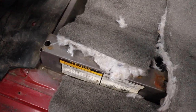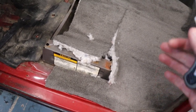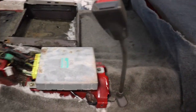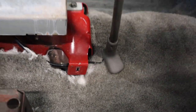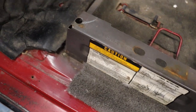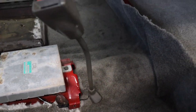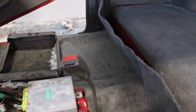This is some of the custom stuff you have to do. Get a nice razor blade cutting around the base of the seat. Leave a little extra material and work your way in — you can always cut more. You don't want to cut too much and be left with an open spot with no carpet coverage. As you're working through the middle portion, don't forget the holes for the seat belt buckles — those are important. If you tighten everything down and put the center console area back together, it'll be a pain to lift the carpet again. It's fitting in there pretty good. Look how good the gray match is.